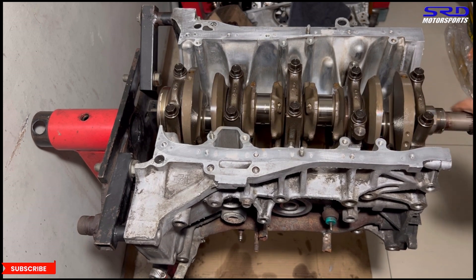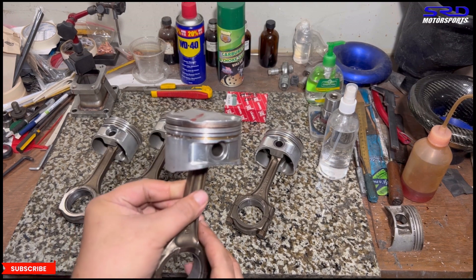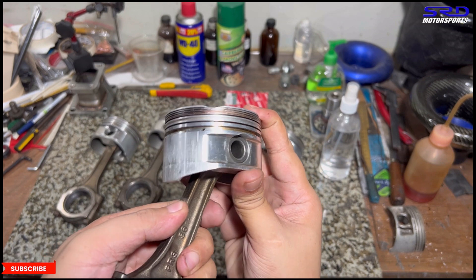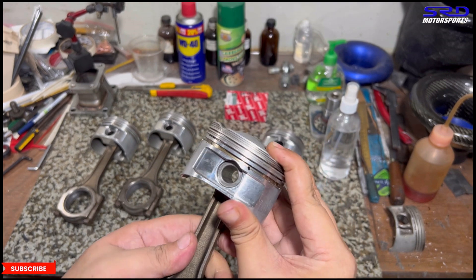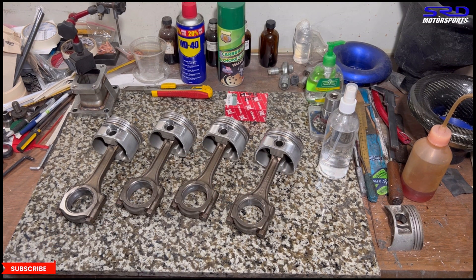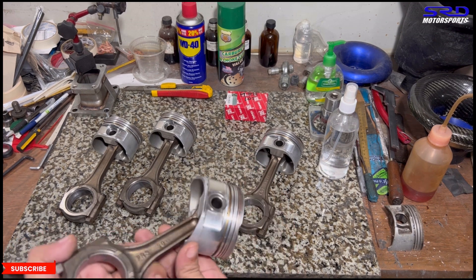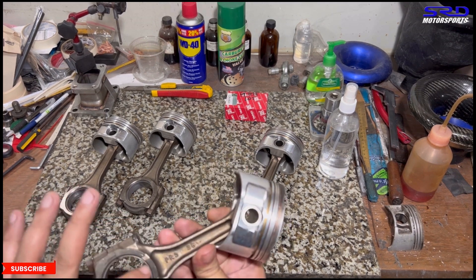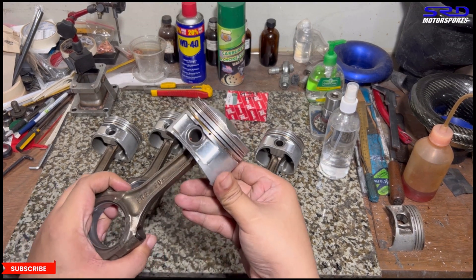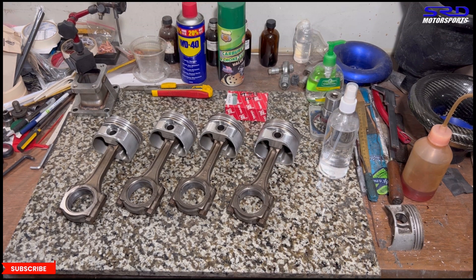Let's head back to the desk to talk about the pistons. Because it's OEM rods, it's a pressed-pin function instead of floating. Since the rod is the one holding the pin, you should not install wrist pin locks — they will get pushed out and start scraping the bore. We've seen hundreds of posts about scored bores from this mistake. Also, because on startup this area is all dry, we lubricate it with assembly lube. The oil slit only throws oil once the engine is running, so it needs to be pre-lubed to prevent scoring.